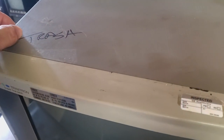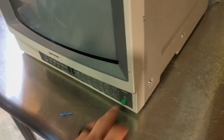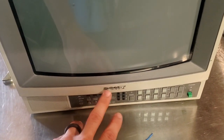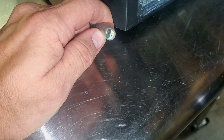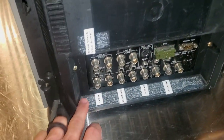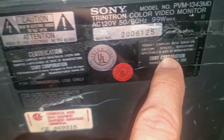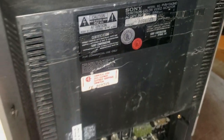Here's the PVM and it does say 'trash' on top of it — I don't think I saw that before, but it's not in too bad of shape. It said it had water damage, but I don't know about that — it doesn't look like it has water damage. The buttons feel nice on the button board, the Sony emblem is missing, but that's okay. Here's the key part of why it was listed as untested: the power cord had been cut off. What we have left is just a stub that needs to be replaced. This residue here looks like leftover from old tape, like duct tape — that's actually a good sign. The manufacture date is September 1990.